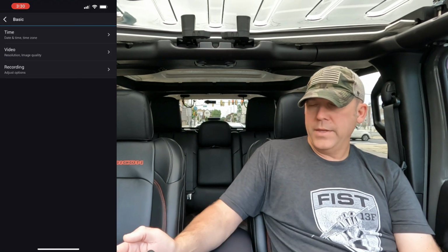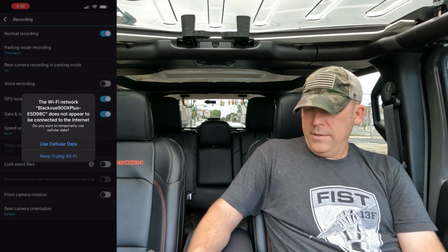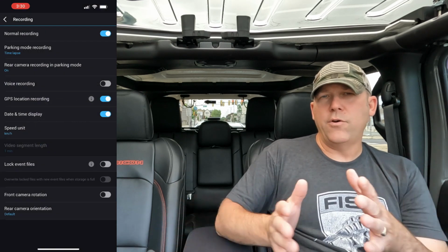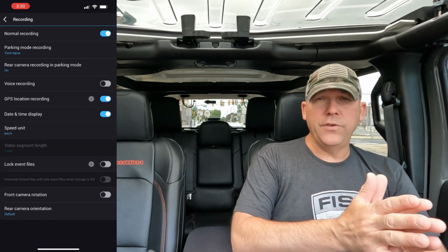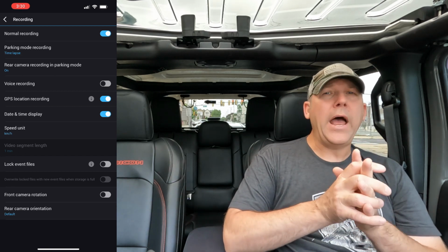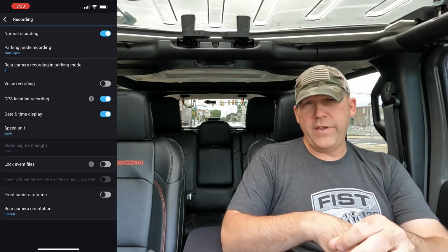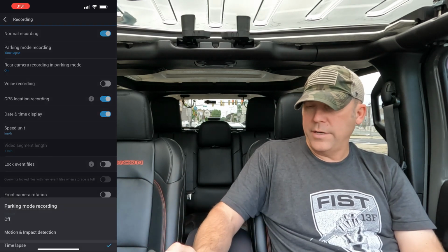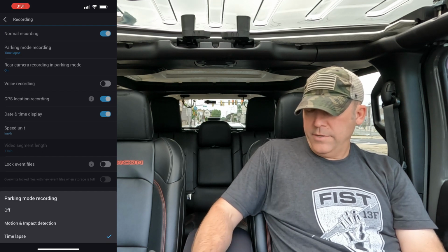Back out of video. We're going to go down to recording now. We're going to click on recording, and it's got parking mode. You can change how parking mode is recorded. We'll cover that also. Parking mode is when the camera is powered after the vehicle is off using, let's say, a parking mode battery. I'll discuss that later. But for parking mode, how do you want the camera to record when the vehicle is off and it's sitting, whether it's draining directly from your vehicle or a parking mode battery? You want to set that up. I have it set to time lapse. I don't like time lapse, but we'll leave time lapse for now.